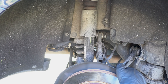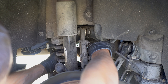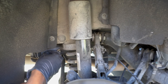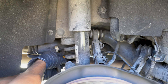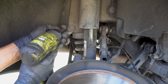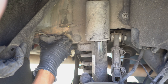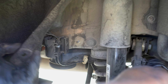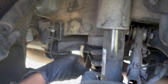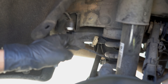To replace the sensor, all we need to do is take the cable from the clips. For some of them you can use a pick tool or a screwdriver. Then take out this 10mm nut. Here's the connector — squeeze it and remove it.